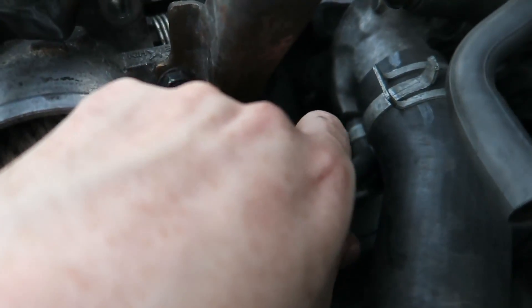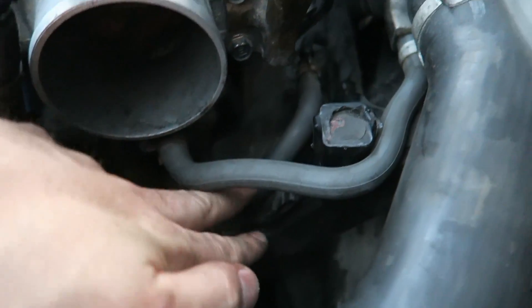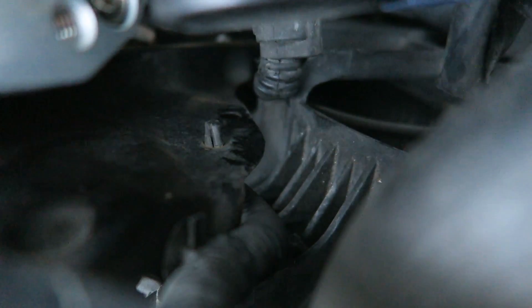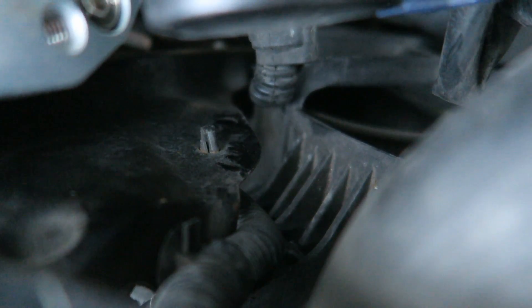To show you what I'm exactly stuck on: those are the bolts going into the manifold, and those are the two that are meant to be going through the throttle body here and here, and two on the bottom. But as you can see they're at a slight angle and the throttle body doesn't actually go in at that angle. Initially I had taken off this coolant pipe and replaced it with a longer one. Then I thought it was another coolant pipe underneath, so I took that out a little bit — still the same problem. It turns out the actual issue is in the bottom left-hand corner: there are leads coming out of the throttle body, and the back of this wire was hitting against the bonnet latch bracket. It's just that bit too long to line the throttle body up properly.